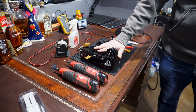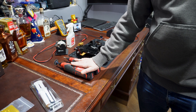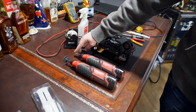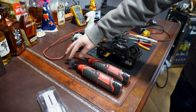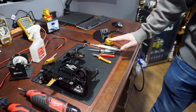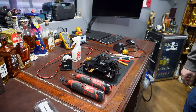If you've extracted your mechatronics, you'll need a few basic tools to make this happen. You'll need a couple of rotary tools — you'll need some kind of burr to grind down a couple of plastic rivets, and then a cutoff wheel because we're going to be cutting open a cover that's made of stainless steel. You're also going to need a soldering iron, multimeter, just a few simple snips, a screwdriver, some flux, and alcohol to final-clean your soldered-in board after.